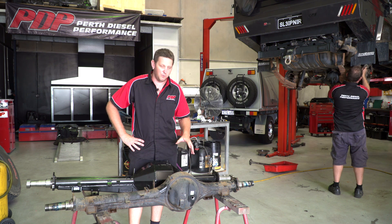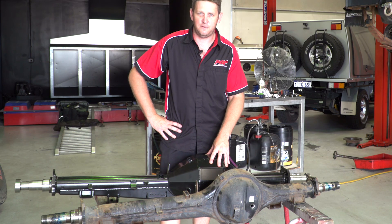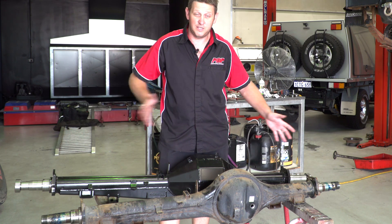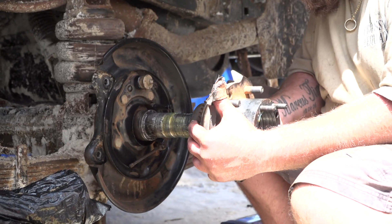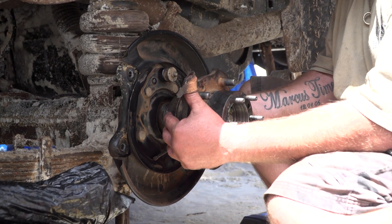So pretty much what we've decided to go for in his car is replacing out the standard diff housing and going for something that's stronger with more gussets, and chromoly axles so we can get away from the axle issue we've had previously. We also had a little bit of damage on one of the threads on the spindle from the bearing failure, and this kit ticks a lot of boxes in replacing that.